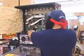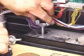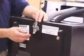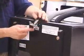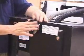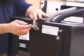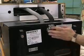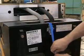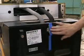Open up the insert panel, pull down the dot matrix, and usually there's a set of wing nuts here that are holding the head in place. Now here's that clasp I was talking about. I'm telling you, take this thing off. It's only like 3 little 1/4-inch hex bolts. Take this thing off and set it aside. Otherwise, when we prop the game up on its butt, this thing is going to get all mangled and bent to hell. If you don't want to remove the latch, another thing you can do is use blue painter's tape, a low-tack tape, to kind of secure it. But I always recommend you just take this sucker off.